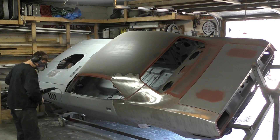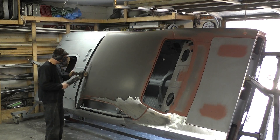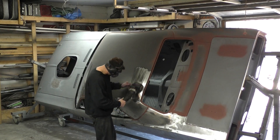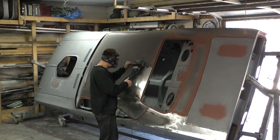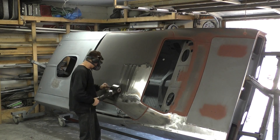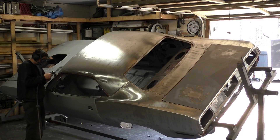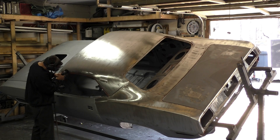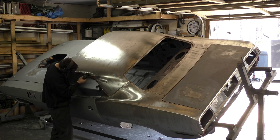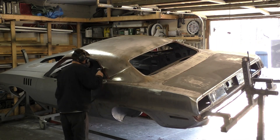Probably the best thing about this Barracuda is I'm stripping brand new panels. You don't know how many times we strip these old cars and it's a mystery what you're going to find. Great thing about this car — we start on the back to the front, there's no surprises here. It's the same coating, everything's brand new, there's no dents in this car. I've worked this car front to rear and everything that is in gray epoxy primer right now has already been stripped down to bare metal. This car currently has no filler on it front to rear. Obviously the SCT with that giant drum can't get into the drip rails — it can't get into where we're going to fill the lead, door jamb areas, wheel wells real well.